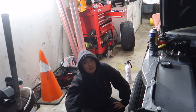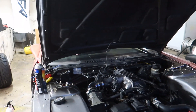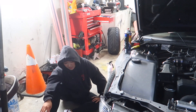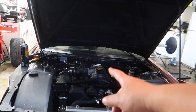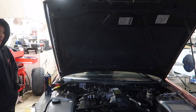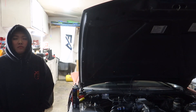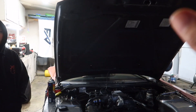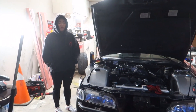The vacuum leak - we need to figure out where the short in that circuit is, and we also need to figure out where the vacuum leak is. It's squealing - can you hear it? It used to be way louder but it's still there. The main issue though is to find what is shorting out on this engine because it's blowing the injector power fuse and that's what's cutting the car out. We need to look through the wiring diagram and see what's on that circuit, figure out one by one what the culprit is. We also need to check the O2 sensors - a lot of times people say that even with heat wrap, the wires on the inside melt. I think we should lift the car up off the ground so we can get underneath and check everything out.